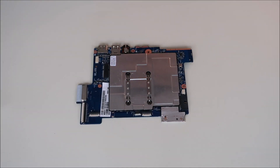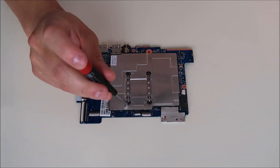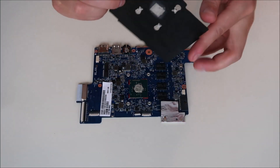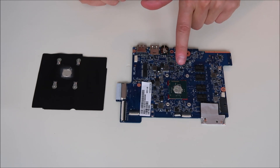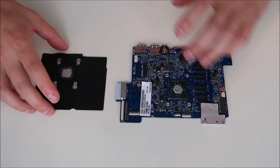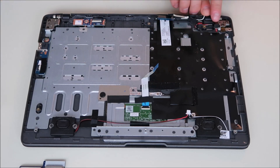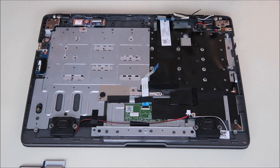As you can see, the heat sink assembly is not very complicated in this computer. You don't see a fan or any large copper components — that's because this is a small computer that doesn't produce much heat and doesn't need a big heat sink. To access your CPU, we're going to take out these four screws holding your heat sink down. There's your CPU — as you can see, it's not easily removable. It's integrated into the motherboard, so you can't easily take it out and replace it, but that's where you'd find it to clean it or apply thermal paste. The USB board is right there, held on by one screw. Your power jack is right here — we unplugged it from the motherboard, and it just pulls right up. If you're looking to access your LCD assembly, all you have to do is unscrew the hinge screws, remove the palm rest, and we'll get to your LCD.